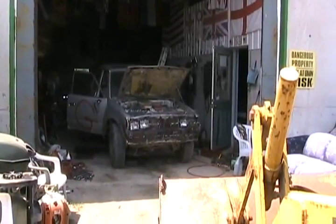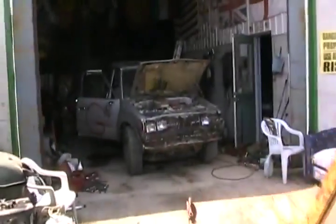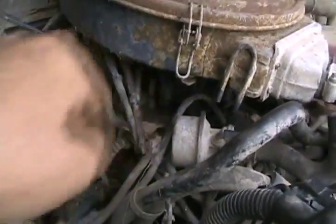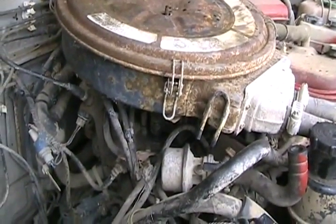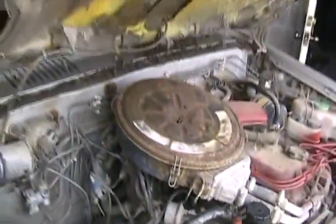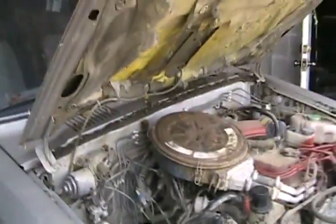She's in the shop. I've been checking her out, got the fluids checked, got a battery in it. The carb was kind of screwed up — when I primed it, it just kept running fuel out of the float bowl, so I think that's fixed now. The float bowl is a two-piece one — you can take this cover off and access, fix, or clean it out. It's so simple. You had to re-gasket it; got corrosion around it and that's why it was leaking.